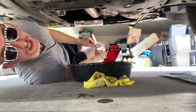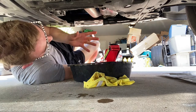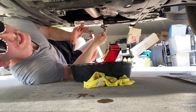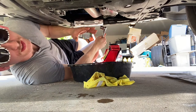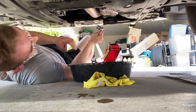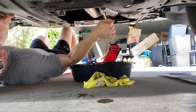We still gotta drop the oil filter, but this pan is actually pretty dang full so I gotta drain this first. I wanted to make a point - whenever you retighten it, just make it barely tight, okay? Not loose, but barely tight. It doesn't need to be cranked down with a torque wrench. Shops, you don't have to crank this thing down with all your might - it's gonna be fine.